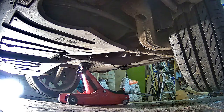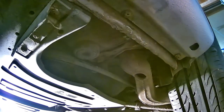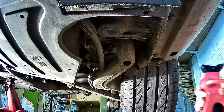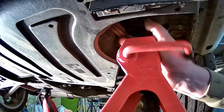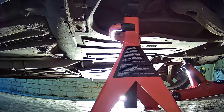With the rear of the vehicle supported by the jack, we can now show where we're going to place the axle stand. Looking at the rear wheel and coming in front by about a foot, about six inches in from the inside, you can see there's this round mount right here — this is what they would use in a garage with the hydraulic lift. Taking an axle stand, we can place that underneath the hydraulic mount, careful not to pinch any wires. You can see it sitting quite comfortably on that; then go around the side and place the other axle stand in position.